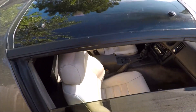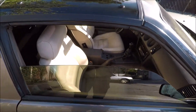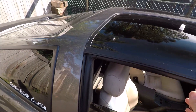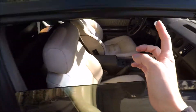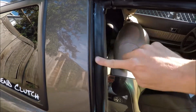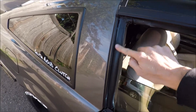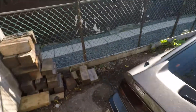What you do is apply it to all of the rubber moldings and weather stripping around the t-tops. A lot of people will do this with Vaseline or something, but this is actually a silicone-based grease, so it's not going to deteriorate your rubber like those other products will. All you have to do is put a little bit on your finger and just go over all the rubber around the t-tops. Rub it in and over time the rubber is going to absorb it and puff up a bit, and since it's a grease it's also going to repel water.